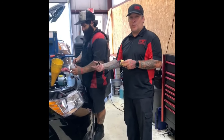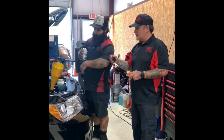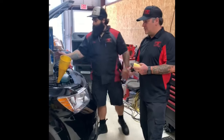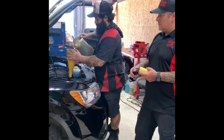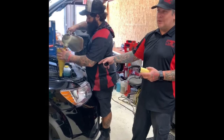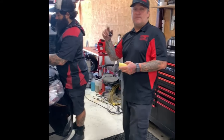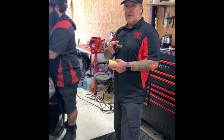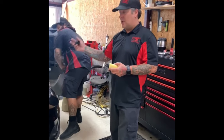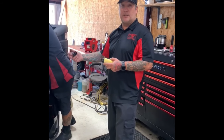We're back now on the top side. Oz put the oil pan back up and got it all resealed. Now this is where we add the MOA — we put that in first, the oil supplement. Oz will pour that in there and we'll get it mixed in with the oil. What's interesting is we did take a peek down inside the valve cover with the camera — it's very hard to see — but the top side inside the engine was very caked up before the service. After the service it was clean; there was no sludge that we could see. These oil passages are really small, so now this oil will be able to go through there and actually keep things lubricated like it's supposed to.